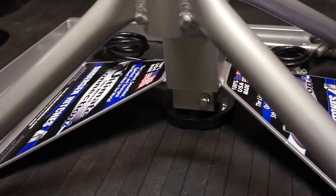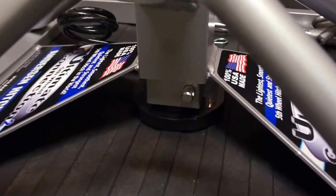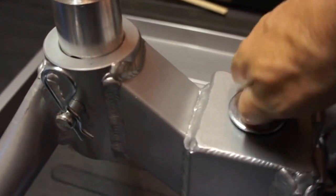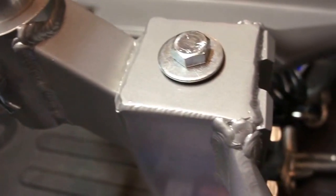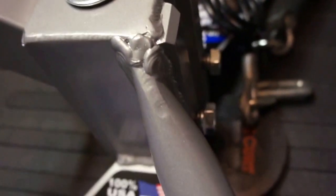Okay, the hitch is now moved, and the center tube is dropped on top of the ball. You can see the cotter pin, or the security pin, still loose. It remains loose. You put the pin in. How do you tighten that to the bed ball? Very simply. We're going to tighten this, and that will raise that lower pin right there. It's going to raise it up until it tightens against the ball. So that will tighten that inner tube against the ball, and then these two get tightened, and that's what secures that inner square tube to the entire hitch.